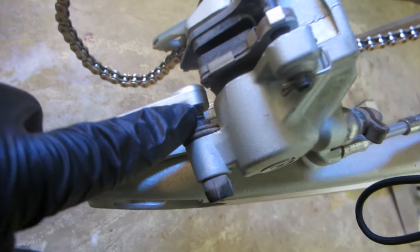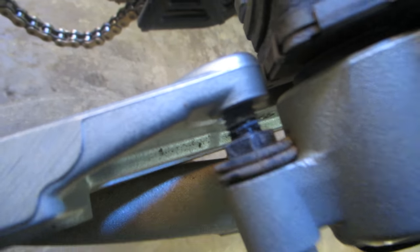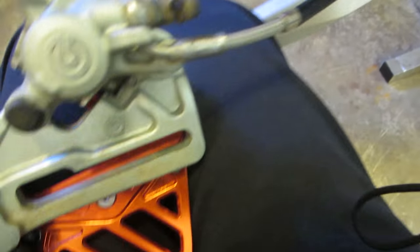Here's a look at the old one and I've already taken this bolt back. It's an 11mm, and you can see on the threads it had some blue stuff on there. That's the old Loctite so we're going to need to get that off.